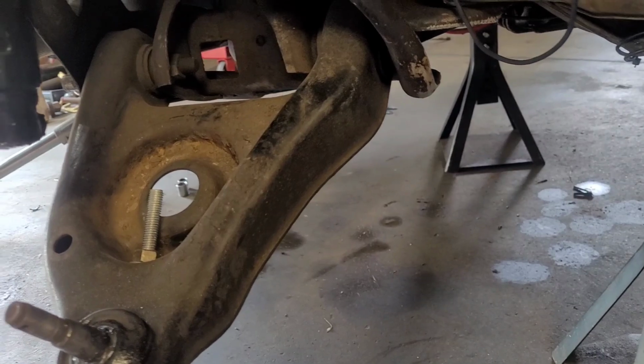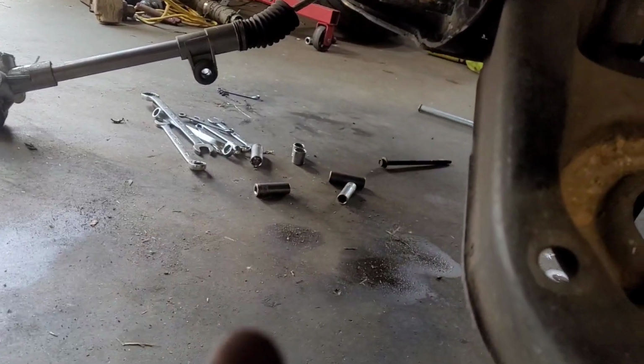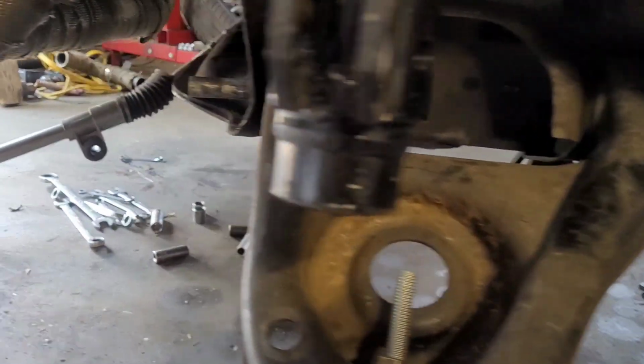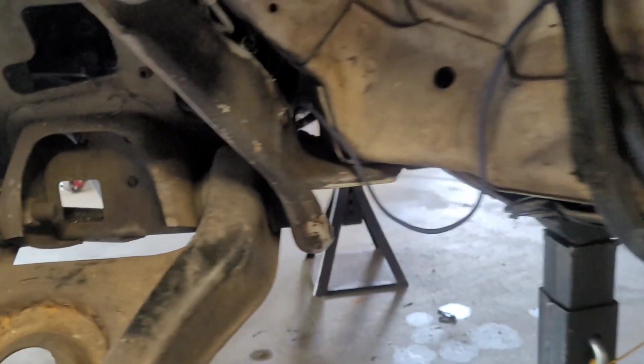We can go ahead and go up here and start strapping the motor off and drop the K-member out. Because once that's out of the way, I can get that strut off and all that over there done, and it'd be just like this. And this K-member is basically 6 bolts and it's down, minus the engine bolts. But like I said, I'm gonna get the brace across the top. Then I can take these hokey mounts that we have made out of here, and then we get on to putting the new one in here.